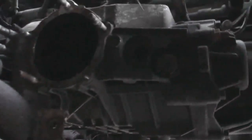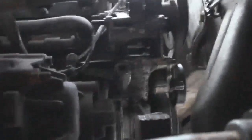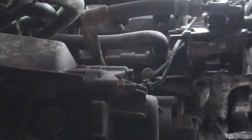So I'm just going to put an axle stand, which I've got in the middle of the car, under the IRD box. As you can see, I need a block of wood in there, and I'm going to just continue undoing them top bolts by hand, and hopefully, once I've disconnected the little breather pipe which is at the top there, on top of the IRD unit. Where is it? It should be on the top here somewhere.